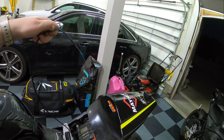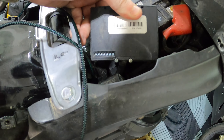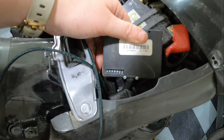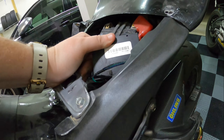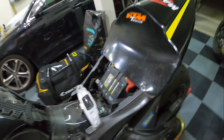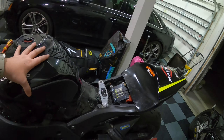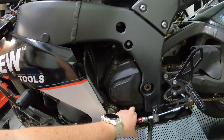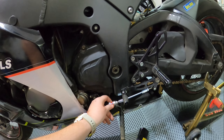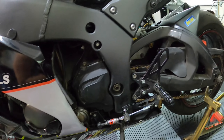I've got my cable up here mounted to the green and blue wires. There are pins on the back — those are the set screws that hold them in. We're going to use three and four for this quick shifter. I'm going to go ahead and do that. Just screw those set screws in. Now I'm going to button up the fairings and zip-tie this wire to make sure there's enough play to shift and that it doesn't go into any moving parts, because that would be very unfortunate with your new quick shifter. Then I'll show you what the setup on the laptop looks like for the Dynojet quick shifter.